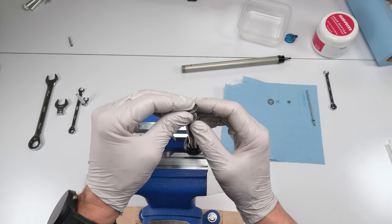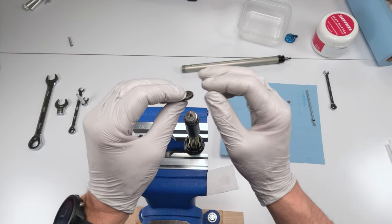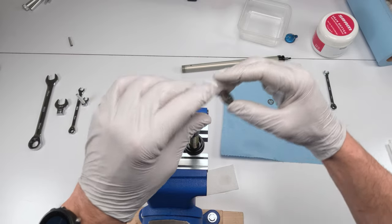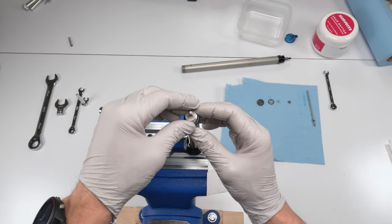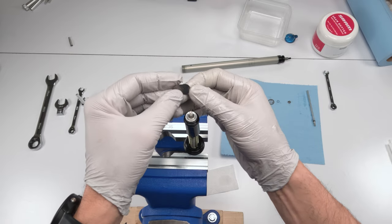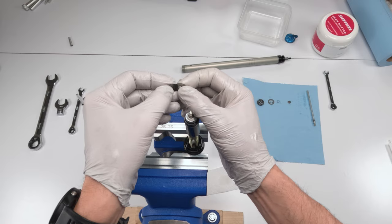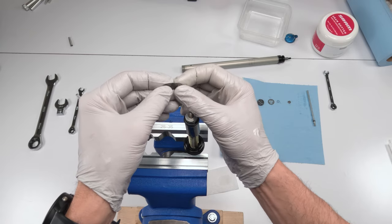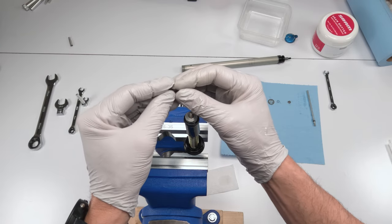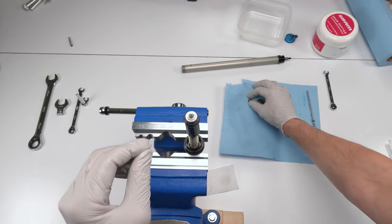Now, we have our compression. I forgot the name of this thing, but this has a seal that needs to get changed. Okay. We have this washer. Three shims, technically, not washer. So we have three shims over here. All right. Four shims. See what I mean? Shims are real thin. You got to watch out. Just leave them in order. It came down like this and put them down in the order you took them out.